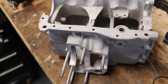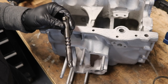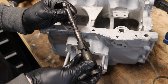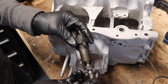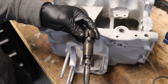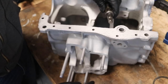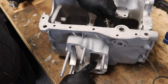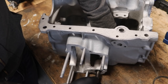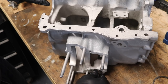To start off, we are going to take our gear selector shaft — this is the shaft that connects to your actual gear selector on the back of your car — and this is the housing for that gear selector. We're going to go ahead and slide those together. As you can see, it doesn't fall out the bottom. You actually install it from the inside: let it in through this hole right here, find it on the other side, and slide your selector shaft right through that housing.